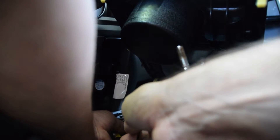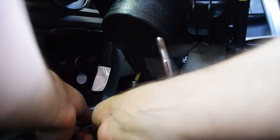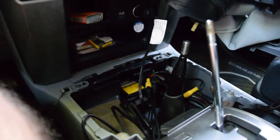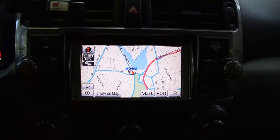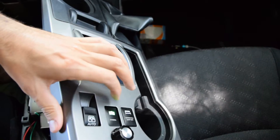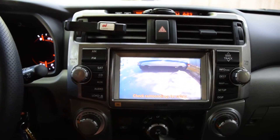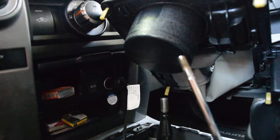Front camera feed, rear camera feed. Just check to make sure you have them hooked up correctly. The relay is normally — I'm going to activate my screen and camera, and you can see that's my front camera. I hooked that up incorrectly, so I'm just going to switch these two.